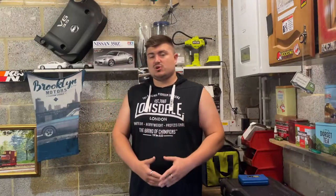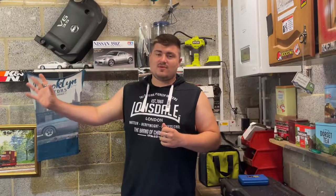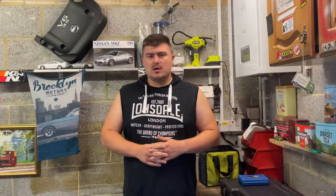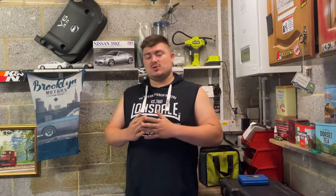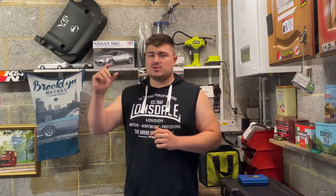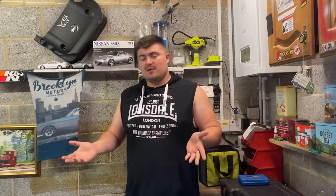Reattach the wheel and off you go. That's how you replace the rear shock absorbers on a Mark 6 Fiesta — definitely worth doing because mine were absolutely destroyed. I'm hoping to do the front ones soon as they're just as bad — around six years old and the roads around here are absolutely terrible. It's not the biggest job in the world, especially on the rears — they're quite easy. Just be careful of those top bolts because they are captive into the bodywork; if they snap they're an absolute pain to get out.